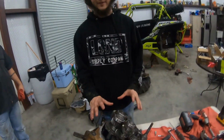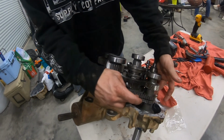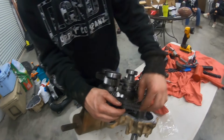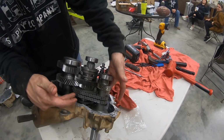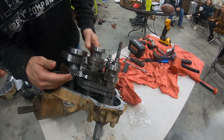All right, so we're going back together here. So we did a low and high gear reduction with a double reverse chain. So we took the factory little single one out, which is pretty much just one of these chains, and we did a double reverse chain, which replaces this shaft and gear and this shaft and gear,